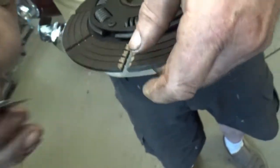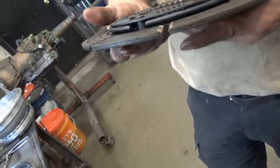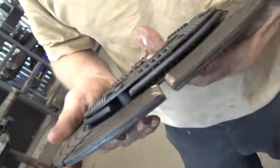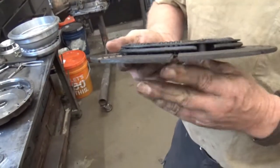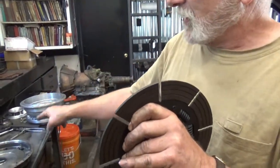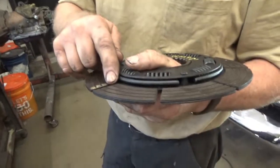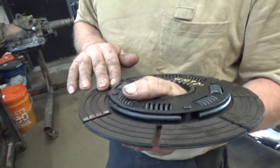The reason you want a chamfer — and we're going to cut it on two opposite grooves, then turn it over and do the same thing on the backside — is that on a cold winter's morning, you start up your Packard and you put it in gear, and then the engine instantly stalls. The reason is that the centrifugal pumping effect of the clutch discs spinning creates a vacuum when the oil is thick, and it actually pulls the clutch disc up against the pressure plate with sufficient power to stall the engine when it's cold. Having this chamfer here makes there be a small cushion of oil that remains on top of the clutch disc to prevent that from happening.